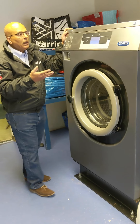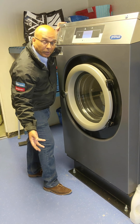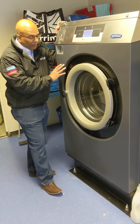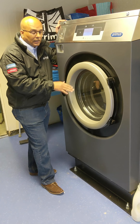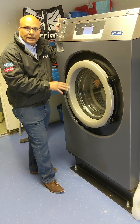The three easy-to-fix parts on these machines are the drain valve, located on the bottom — simply a couple of jubilee clips, take the old component out and put the new one in. The door lock is very simple: literally front panel off, a couple of screws, and it's a plug-and-play connection. Unlike the predecessor version, the previous one was quite expensive and a bit fiddly to fit.